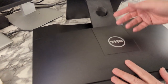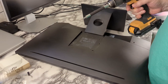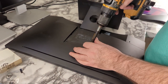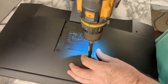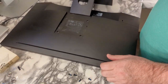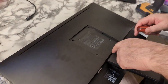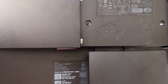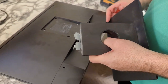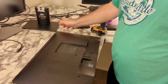For these Dell monitors, it's pretty nice — it's just got a cover on the back, and you pull the cover off to access the screws right there. You can use a drill to take these off, just be careful when you put it back on not to over-tighten, so you may want to use a regular screwdriver. Your monitor may be a little bit different, but once you unscrew this one the base will slide out. If you look down in here there's a little picture of a pin — you just take your screwdriver or a pin to pop that in there and then this slides out. Then you've got your nice little stand there and we can put in our new one.